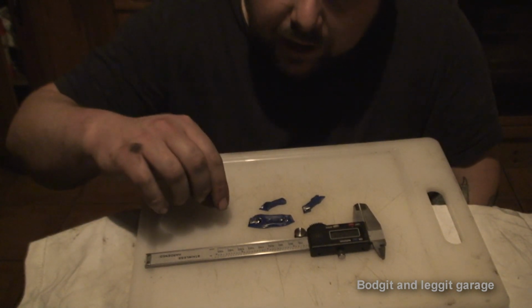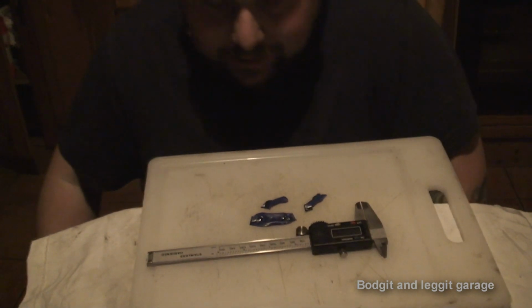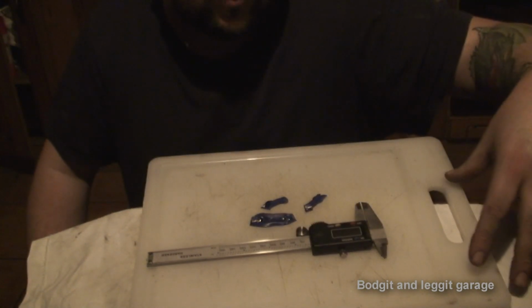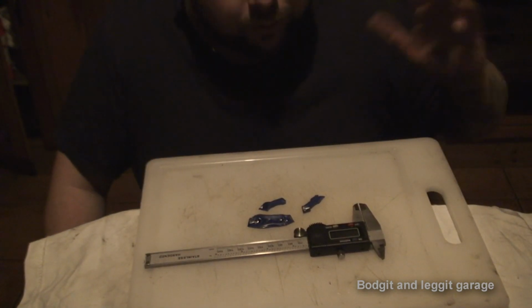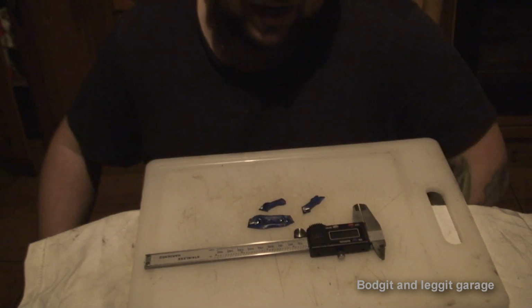It's your exhaust side that normally would put a bigger impression on your plasticine. But it's a good thing just to check them all. That's why I marked each individual one, because as you can see, number four cylinder didn't particularly go very well. You just got four chances. If you just do one and the plasticine moves for whatever reason, you're kind of in trouble. So I just like to do all four. Just gives me a better chance.